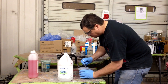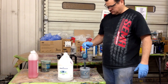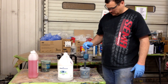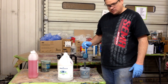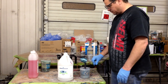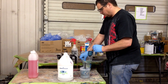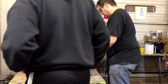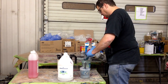This is a viscosity cup — it measures the paint's viscosity. With waterborne this can be really handy. Let's say you had some left over; it's going to get thicker because some of the water evaporated, so you don't know how much to reduce it. So you measure it, and it will tell you — if it's between 18 and 24, or whatever the technical data sheet says, you know it's right. If it's too thick you're going to have to add more reducer. You pull it up — it has a hole in the bottom — and you time how long it takes the paint to go through the hole. After you see the stream break for the first time, that's when you stop. Waterborne doesn't have a catalyst — it just takes reducer.